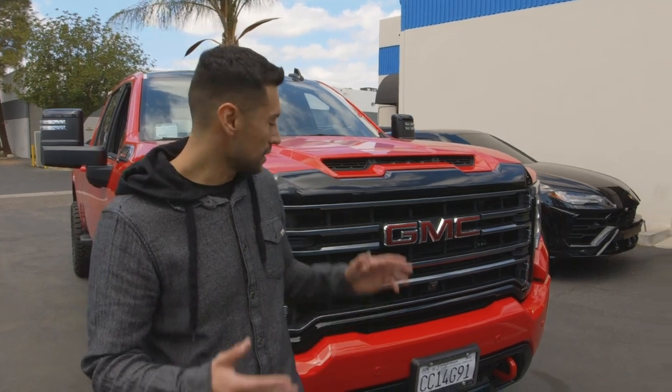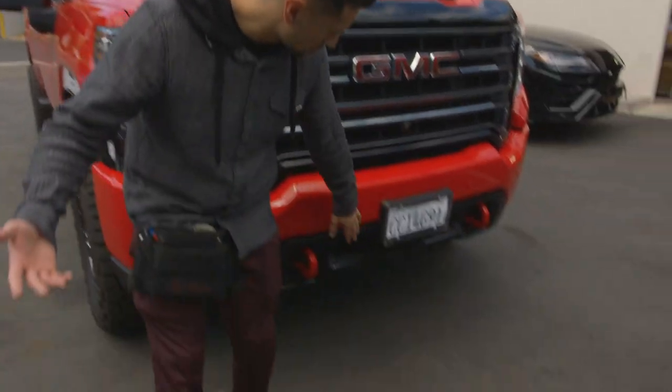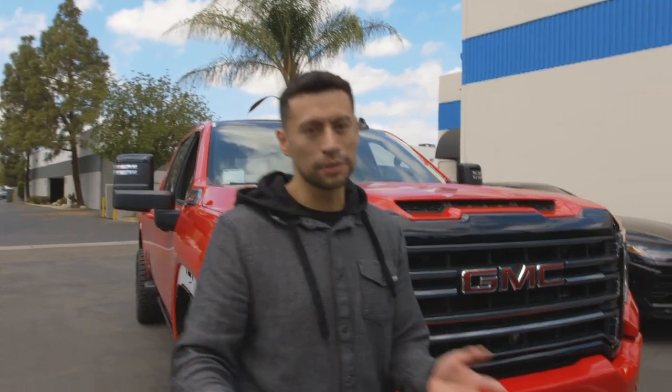Now that we finished up the bumpers, as you guys can see, everything is put back together and it looks really clean. I know there were some areas where it did show white — that's where you have to keep in mind where your trims are, because if you trim a little too far back you may show white. But with this vehicle there's some black here that covers up some of those areas, and once everything's put together it looks really, really clean. You guys can apply pretty much all the basic knowledge we used on this bumper to other bumpers — the theory of stretch versus cooling, heating, and so on. As you go further along in your wrap experience, it's going to get easier the more you do. Drop a comment below, like and subscribe, and if you want to see how to wrap other panels please let me know and we'll try to cover those for you guys.